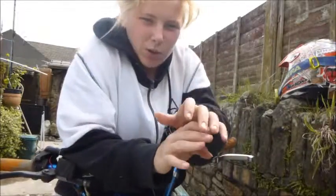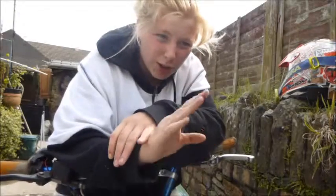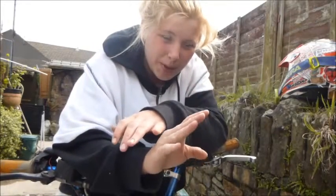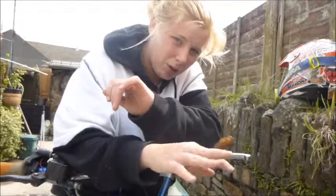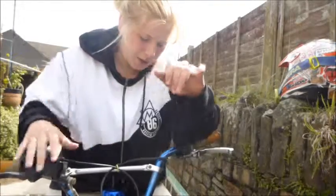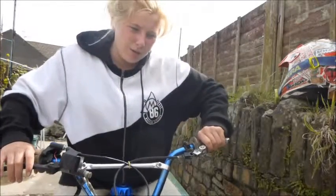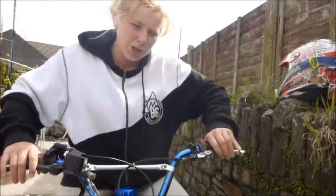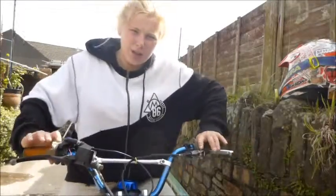Also, this is what confused me the most. Once you're at the highest gear, which on mine is fifth, or fourth or fifth, to go down a gear, well, any gear actually, you've got to go down. It's not just going to go back automatically. You click through the gearbox, hold the clutch in, and let it go every time you go down. You can hear it go, na na na na. And then into neutral, and then you're away to go.